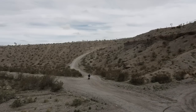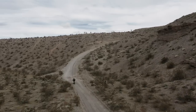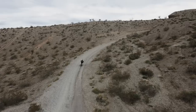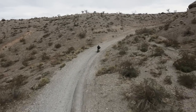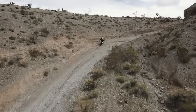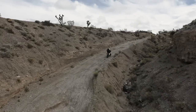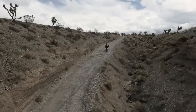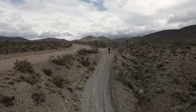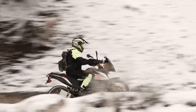Power-wise, even though they call it a 390, it's a 372 — there's plenty of power almost all the way through the range as long as you're looking at torque. It pulls, and you can do big, giant throttle openings even at low RPMs without getting bursts or jerks, which is great for a beginner or novice rider who may not have high-level throttle control. It kind of gives you just enough to push you forward. They also have MTC — motorcycle traction control — and you can turn it on or off.